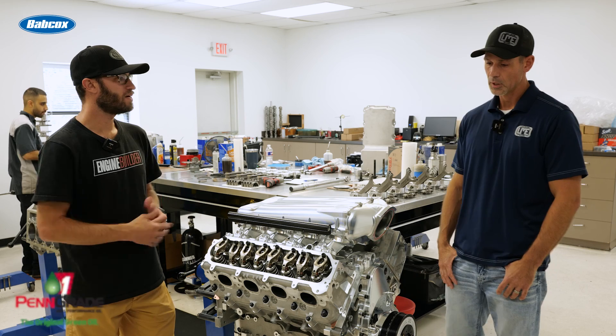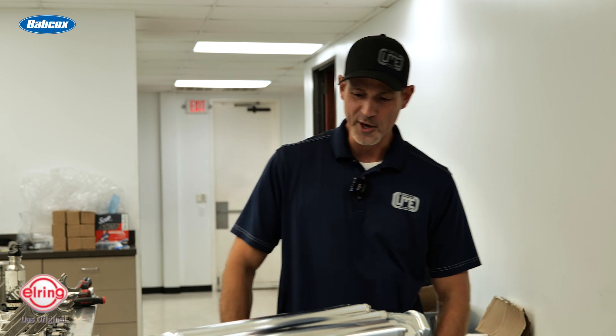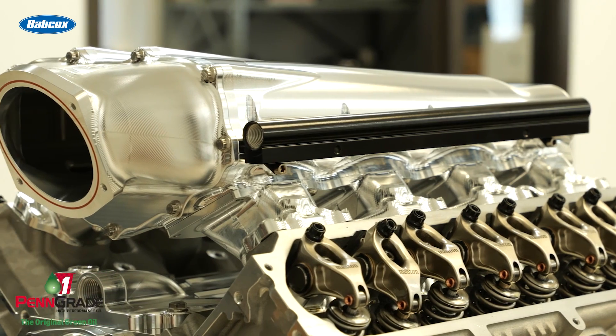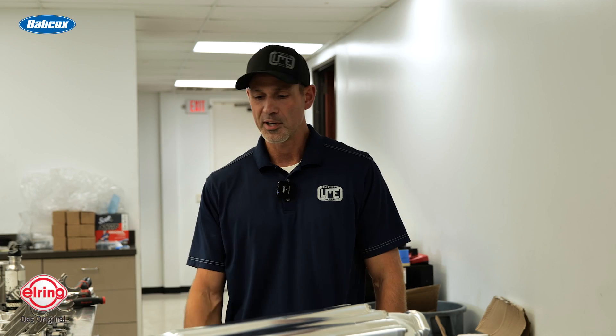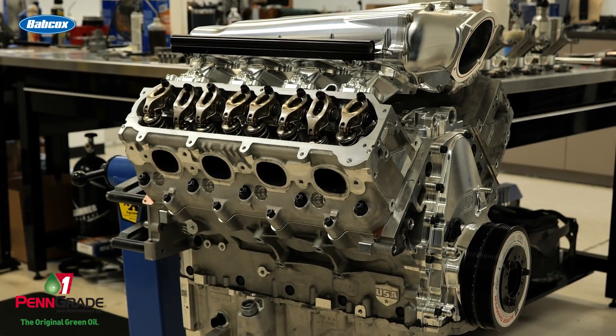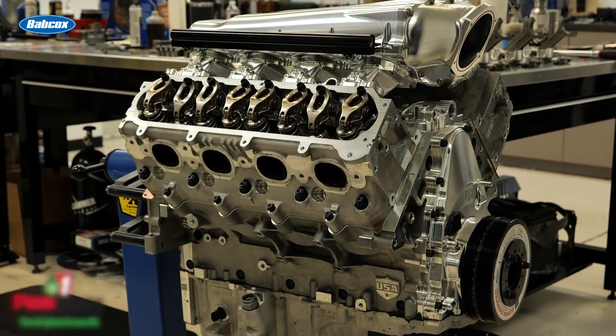Really, really the RPM. I love the 440 combo — the big bore and relatively large four inch stroke just takes the 427 to the next level. We opened up the chambers and ran a specific chamber design to take advantage of the larger bore on this one. As engine builders, we love a naturally aspirated engine. Everything is boosted these days it seems, so when we get to build naturally aspirated engines, it gives you a little more ability to do everything you can to squeeze the power out of it. This one's been great — it was screaming on the dyno and it was good stuff.